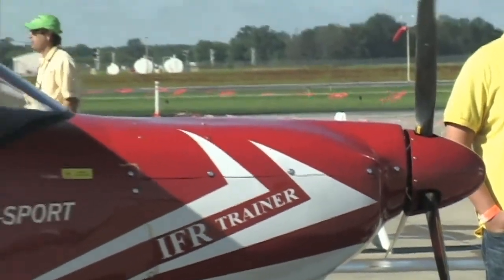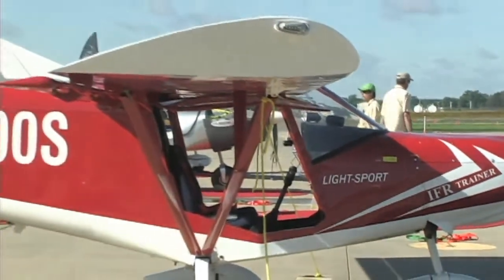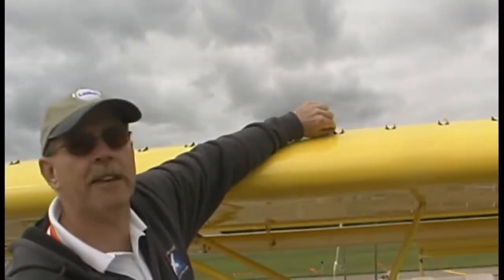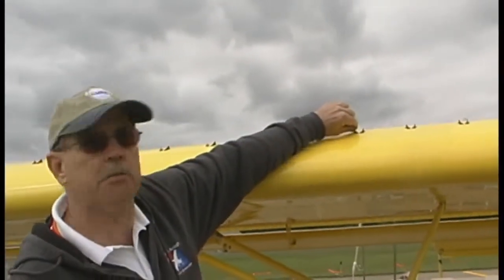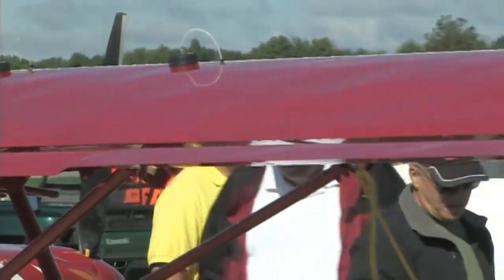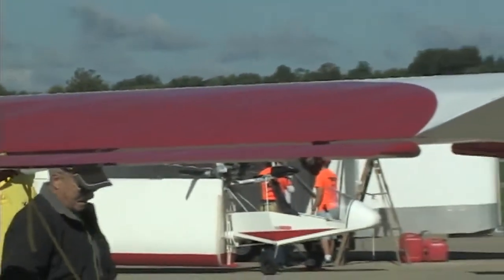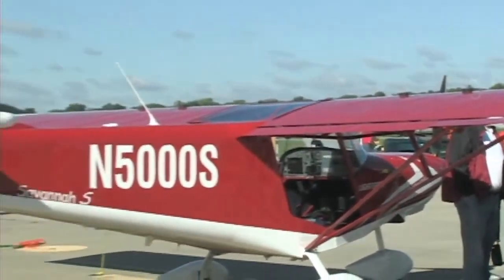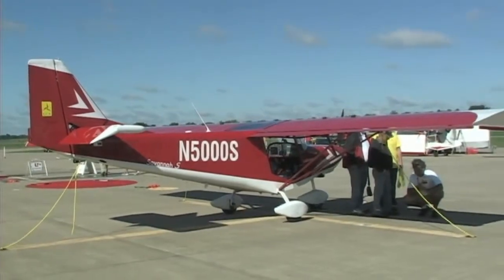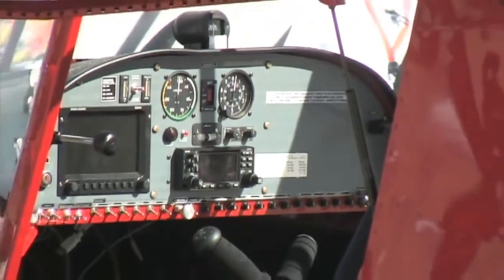It has a little longer nose and a wider cockpit. All these little black pieces of plastic up here do some real magic — these are vortex generators. It always amazes people how a piece this small, arranged all the way along the leading edge of the wing, can make the airplane take off and land even shorter. What appears to disturb the airflow actually makes the air hug the wing better, giving you better low-speed performance and making the STOL characteristic that much more solid.